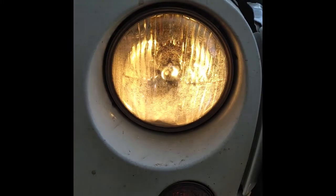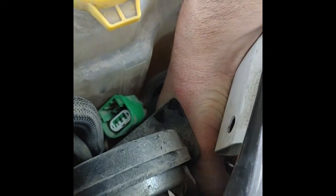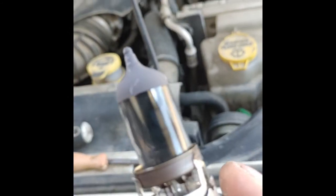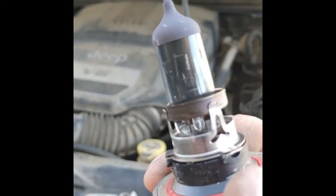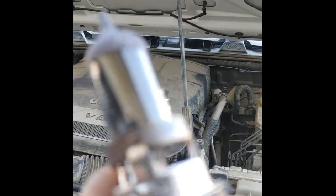And that's the bright — you can see a little more. So yeah, let's put that LED in and we'll see a difference, I'm sure. I've got the power unhooked. The lights are right down here by the horn. They said you can take the grill off the front, but I got small hands so I'm just gonna do it this way. The other side might not work like that, but this side will. There's the big old conventional halogen — looks like one filament might be burnt or something, the glass is all smoky. No wonder they're terrible.